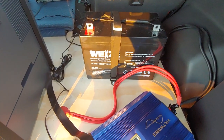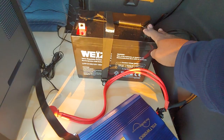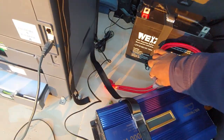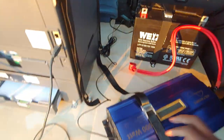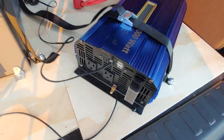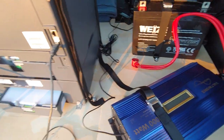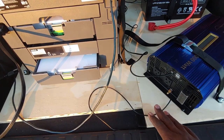I haven't started using it yet because I've got a couple hours before my signing, but the connection process is: connect your black wire — your ground wire — first, then connect your power wire, your plus. Turn her on, plug everything in, and you're good to go.